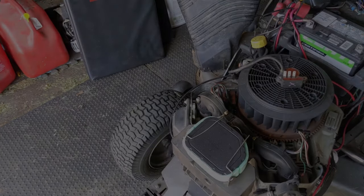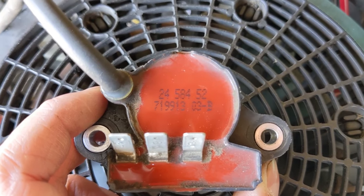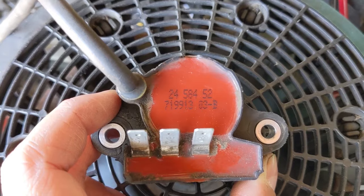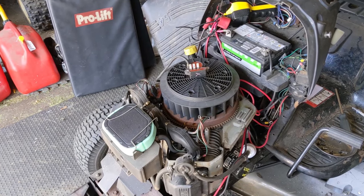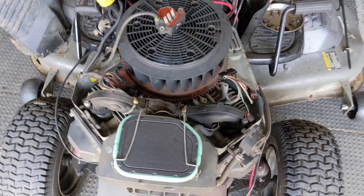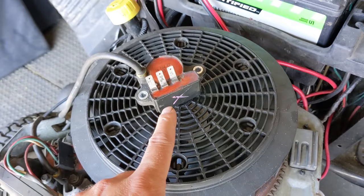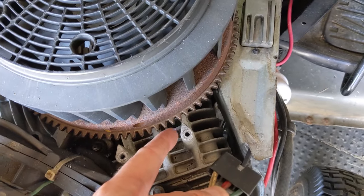You can see the upgrade part numbers there. For example, ignition module part number 24-584-52 is an original module with no diodes. The updated version ends with an 8.9. Before looking up replacement modules, I had to figure out whether the issue was a failed ignition module or perhaps a problem farther back — maybe one of the 12-volt charge wires that supplies the ignition modules had shorted out somewhere before reaching the module itself.